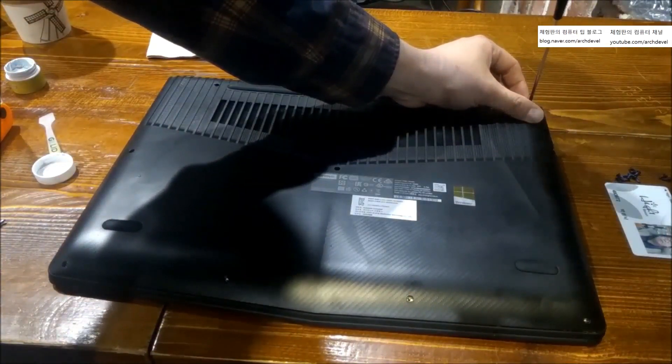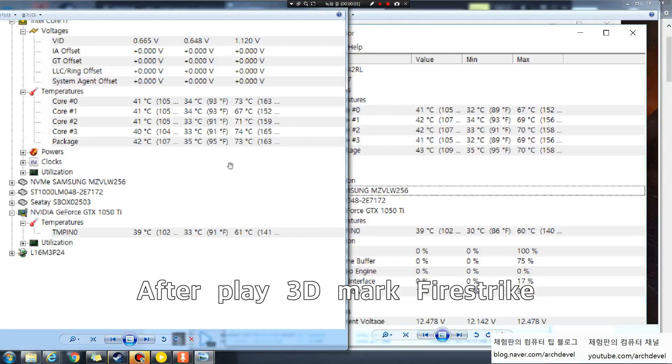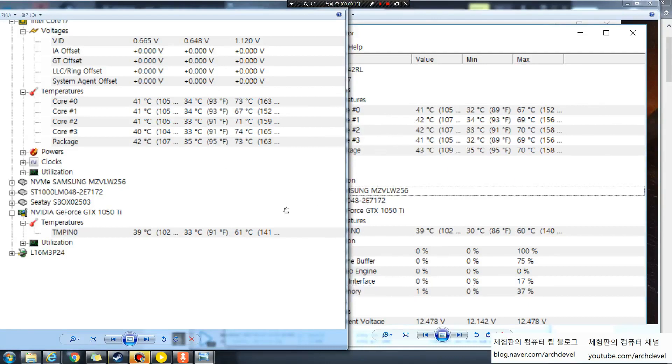Let's see the Fire Strike results. The left one is before and the right one is after — here is the CPU and here is the GPU. You can easily see the changes in temperatures. Even though the factory thermal paste was fresh and sticky, replacing it with a high quality paste changed the temperatures noticeably. I would recommend repasting when you buy a laptop immediately, because keeping temperatures lower extends the laptop's lifetime.